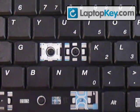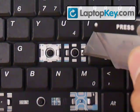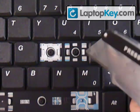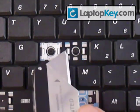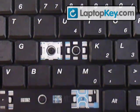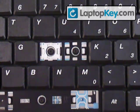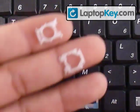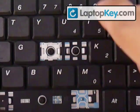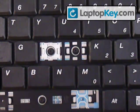We're going to start out by finding the metal plates on the keyboard. You can see that to the right there's a metal hook, and we have the same metal hook towards the left. Those determine the position for the hinges, so make sure to look at the different keys because they can change position. Sometimes the hooks can be top and bottom instead of left and right.